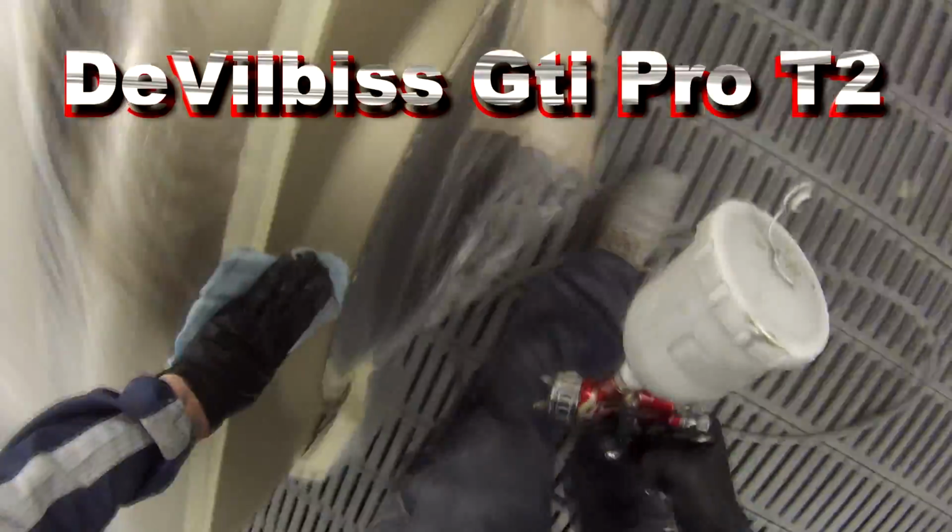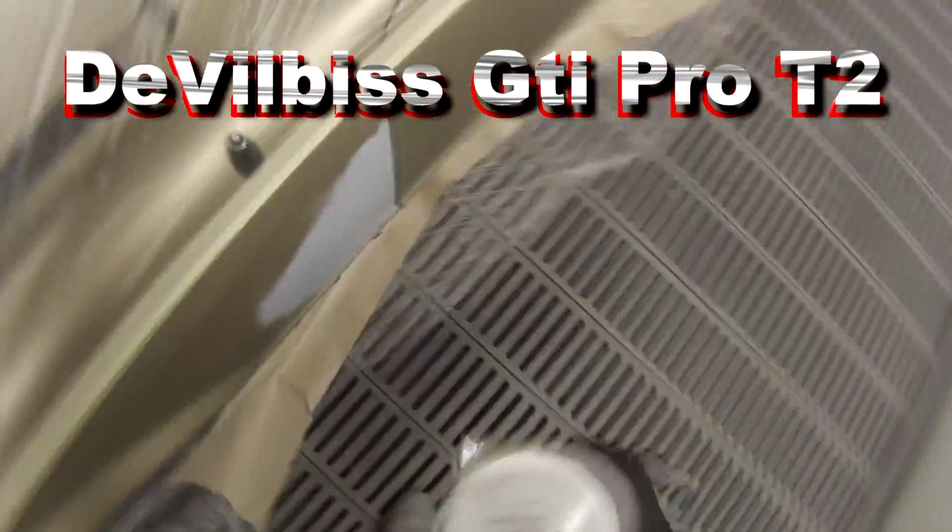So next up, I let that dry for a couple of minutes. I'm not tack ragging straight over that wet base coat. I've got my tack cloth with the spray gun in the other hand. You could alternatively use a high pressure air gun. I'm using the blue tack cloth this time, and sometimes you see me use the yellow ones. Yellow is basically high tack, blue is more of a base coat tack rag. However, this was probably just the cleanest one sitting in the booth at that time, which is why I grabbed it.